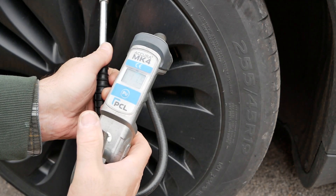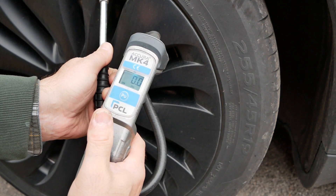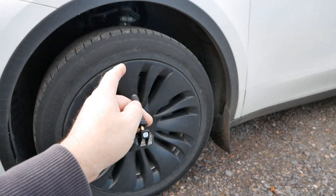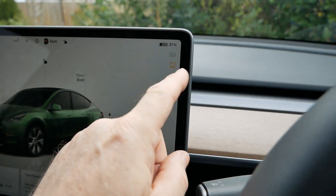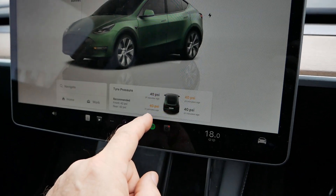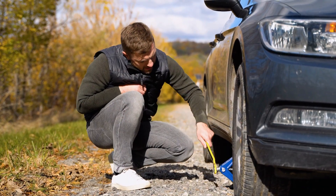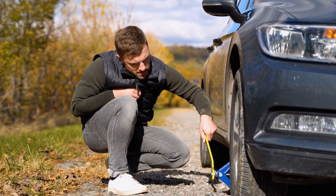When you adjust the pressure in your tyre, the car might not see the new pressure until you've driven a couple of miles, because driving will wake the sensor up and then the car can read the current pressures in each individual tyre. If you get this symbol on your dashboard or screen and one tyre is significantly lower than the others, that's telling you there's a puncture in that tyre — you're not just looking at small fluctuations due to temperature.